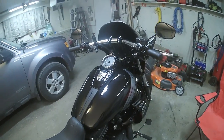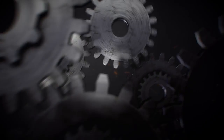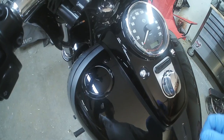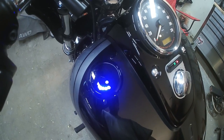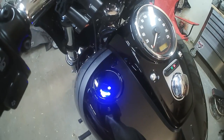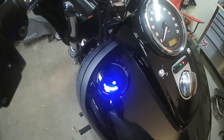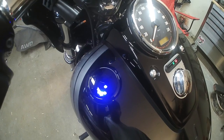Hey there guys and gals, this is Autotech and today we are going to be removing a Dyna fuel tank. One tip to make this process a lot easier is to make sure your fuel level is a little bit lower. This will prevent you from having a bunch of fuel get all over the ground when you unhook that front crossover tube.